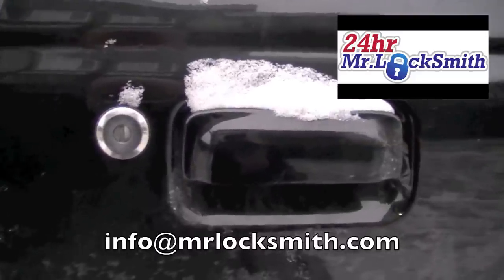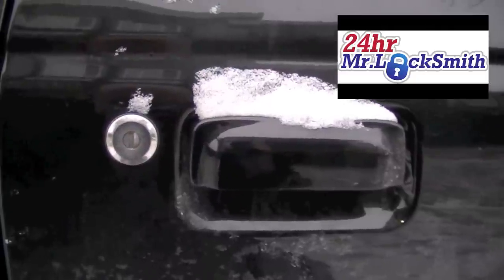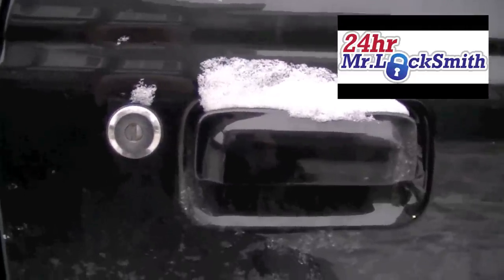If you have a hair dryer and a long extension cord, use that. We actually use a 12-volt hair dryer that we put on the lock with lock de-icer. Sometimes we have to do the whole door because it's frozen. In conclusion, don't use boiling water — it'll cost you hundreds of dollars on some cars to fix. Try to use lock de-icer. Usually there's just a little bit of water in your car lock, so it's not that difficult to get it cleared out with a little heat, or lock de-icer is the way to go. This is Terry Wynyates from Mr. Locksmith — thank you.